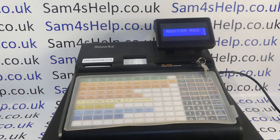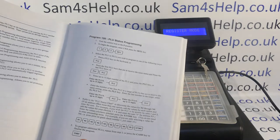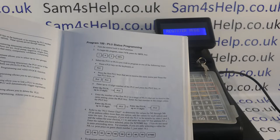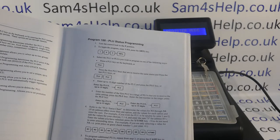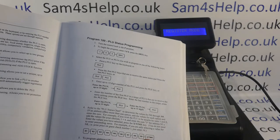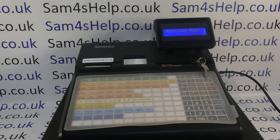What I'm going to do is change the status to inactive. If you've got access to the manual, you're looking for PLU programming — status programming in particular. It's P mode, 100 subtotal, press the PLU, then enter the nine digit code for the status, X time, and then cash to save.